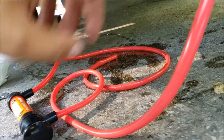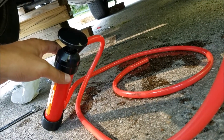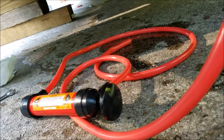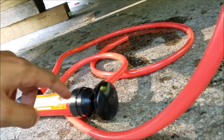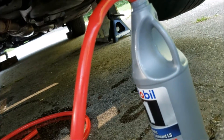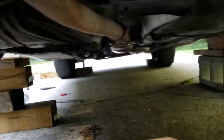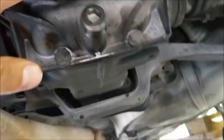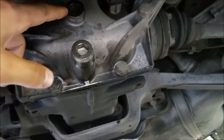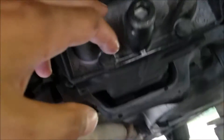What I've been using for this is a little pump I bought from Harbor Freight — basically it was like five bucks. It's got two hoses and you just pump it. One side you use to pump from the gear fluid bottle, and the other side you use to pump into the top fill hole right here. You leave the top hole open when you're filling it, and go ahead and seal the drain bolt.